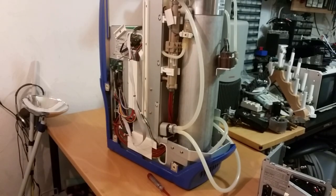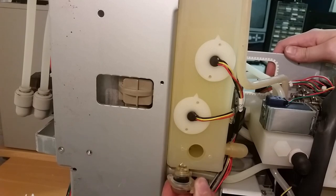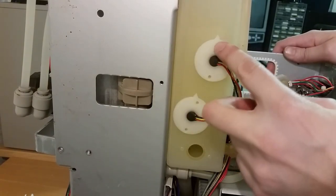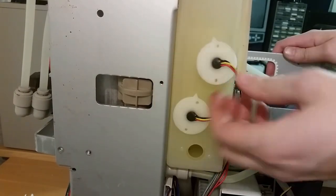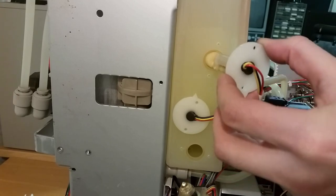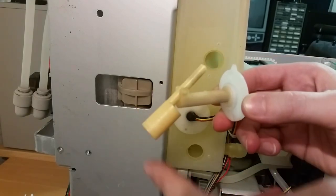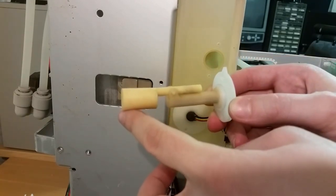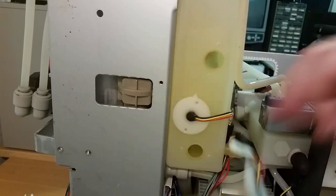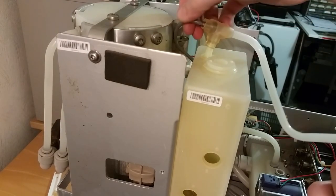Now it's time to chop this thing to bits. If we remove the sensors, let's begin with this one — these are level indicators. This arrow here shows that this part must be up; we'll see soon why. Turn it down first, like this, now I can take it out. So when the water reaches here, this will float up — there's a magnet in here and a reed switch, and it will make contact. Here on top you can see the water input, and we've also got a temperature sensor here.